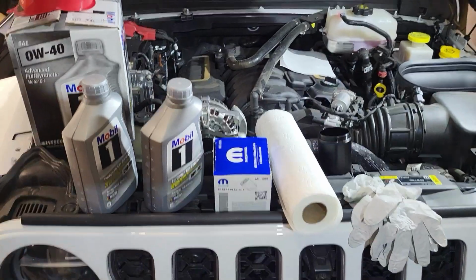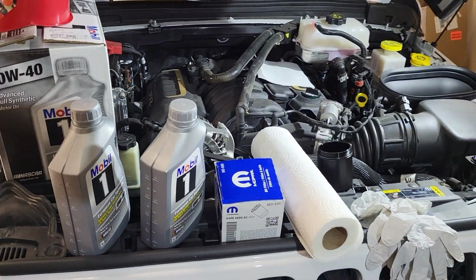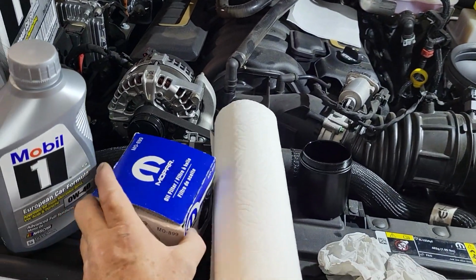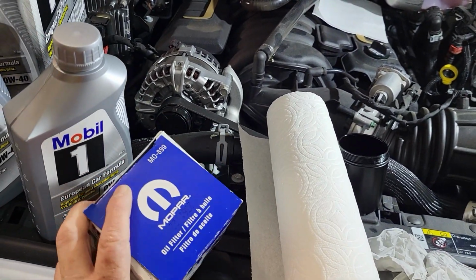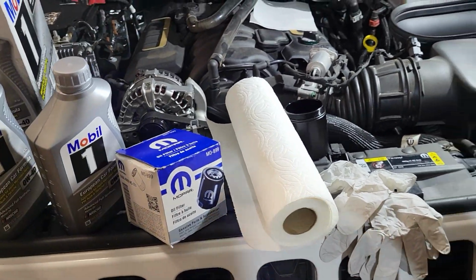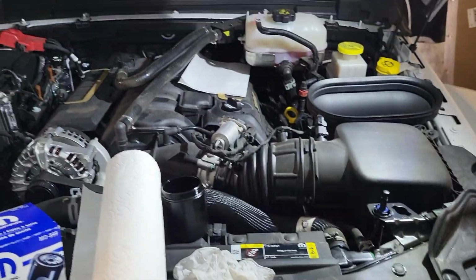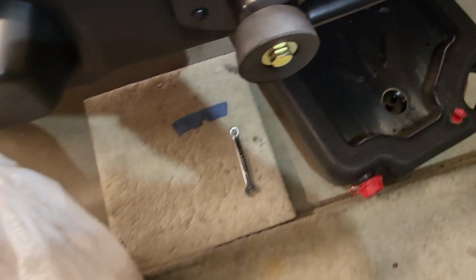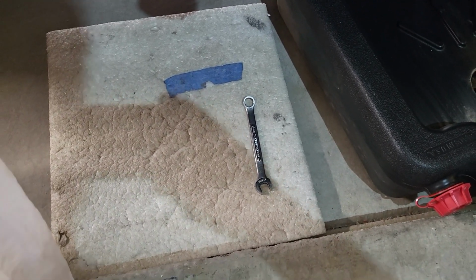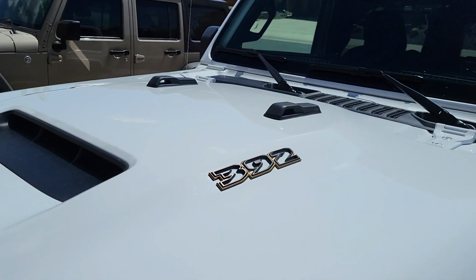So I have oil already in the shop, 0W-40 weight, and I stopped by Advance Auto. They have both the 339 and a larger 899 Mopar SRT filter, and paper towels, nitrile gloves, and a 13mm wrench for the drain, and my drain catch can, and of course a nice poly pad to put your knees on. I perform an oil change.